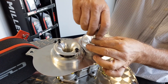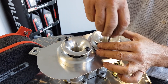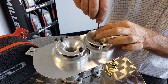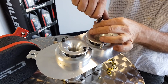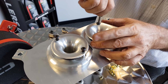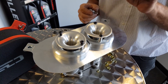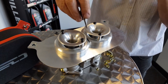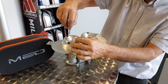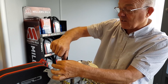The thing you do have to be careful of is just when you're tightening them up — not to over-tighten these. As you see, if you over-tighten it, it kicks it up. Make sure they're centralized as well because there is a little bit of wiggle room. What I would suggest is when you put these in, a little dab of Loctite on the bottom of the screw, because they vibrate around a lot. If you get one of these to come off, there's only one place it's going to go — straight down into the inlet port and wreck the motor.